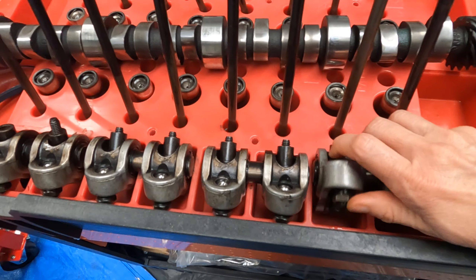I'm planning on reassembling the heads myself. That's really why I have this engine and why I'm rebuilding it — I just want to learn as many of the steps as I possibly can. So we did test fit this cam in the block just to make sure there was no wiggle between the journals and the bearings, and also to check the end float. And beside that, it was good practice for me to fit a cam in a block, which I've never done before, as it seems to be one of those things that can go wrong pretty easily.